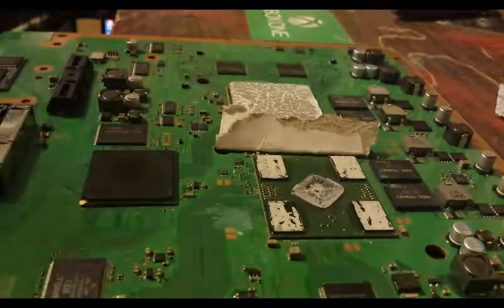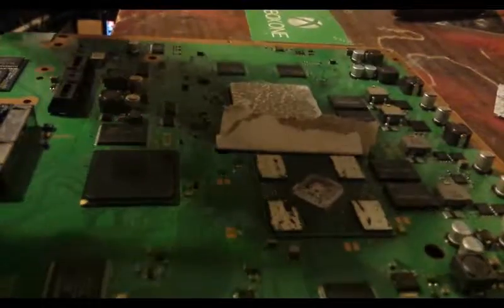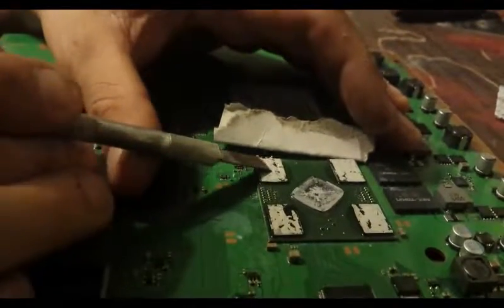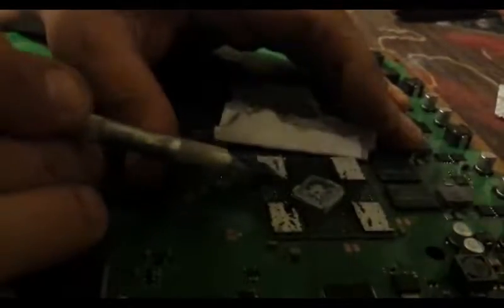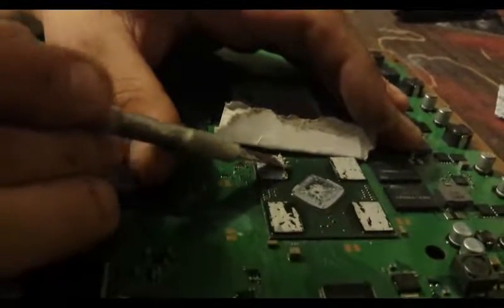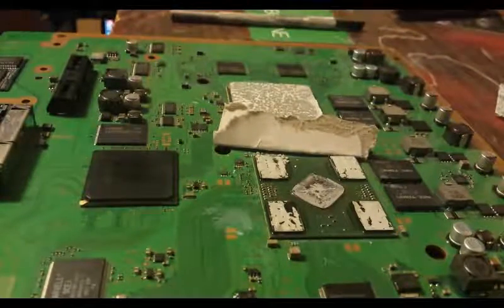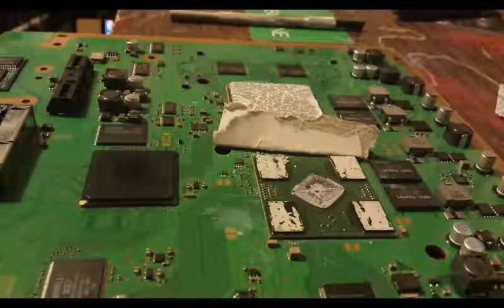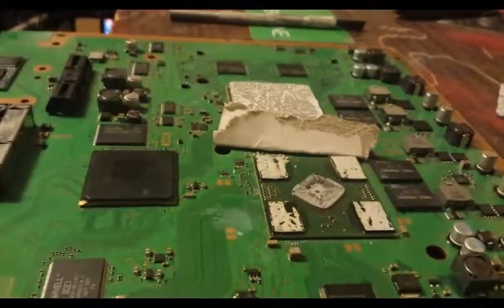What I'll go ahead and do now is take my X-Acto knife and just start chipping away at the thermal paste. It'll slowly come off. I kind of just go over the top layer a little bit and then use this remover that comes when you buy Arctic Silver — thermal material remover. And here's what you want: some Arctic Alumina. It's kind of more of an epoxy. That's what I use on the dies and the RAM chips.